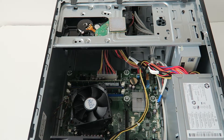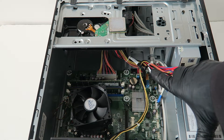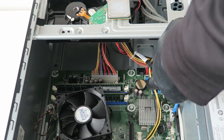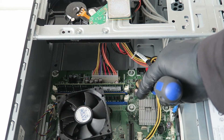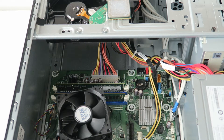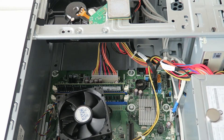Okay, the last part is the CMOS battery right here. This machine is from 2012, so it's five years old, and I'm going to replace the battery so I don't have to do that later. What you guys need is a flathead screwdriver. There's a clip right here on the right side — you take the screwdriver, press on the clip, and your CMOS battery will come right out just like that. Here's the older CMOS battery, and I'm going to install the newer one right there.